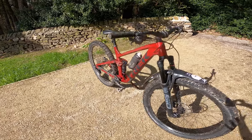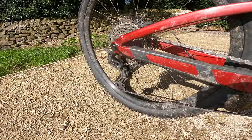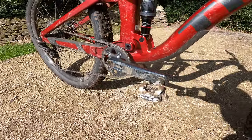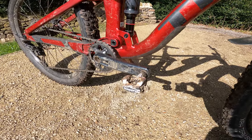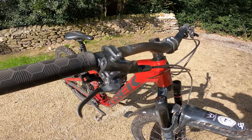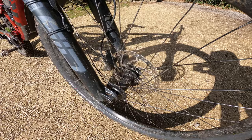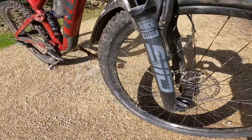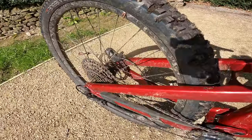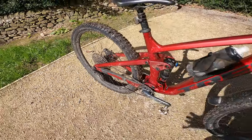You're getting some decent kit on this. They've gone for the classic highlight-the-rear-mech option with an XT, then you've got an SLX crankset — which is a perfectly decent crankset — and then Deore brakes. It kind of falls off a bit with the Deore brakes; they're okay, rotors are a bit soft. These are the four-pot ones so they actually stop okay even with a 160mm rotor on the back, but it's definitely a mixed bag in terms of the stop-and-go equipment.